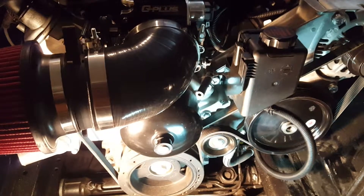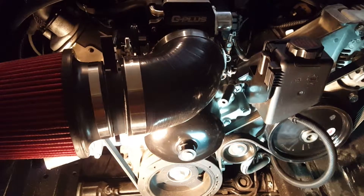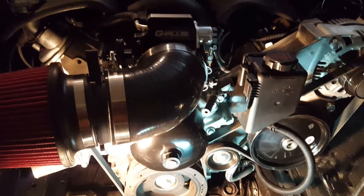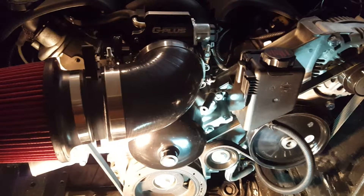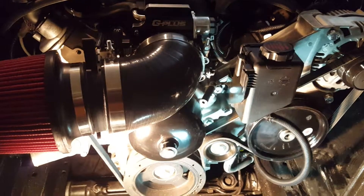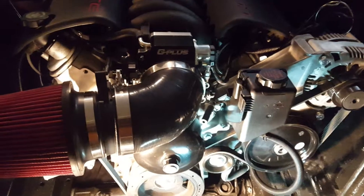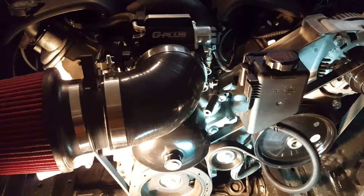A Ford Mustang 2 rack will only take around 850 to a max of 870 PSI. So if you try to hook up that 1300 PSI — even if you get a line made and hook everything up — you're going to blow out all the seals. Just a little critical information you need when doing a Mustang 2 front end with an LS swap and connecting your power steering pump. Like, subscribe, and follow — thanks for watching.